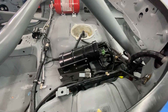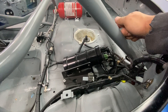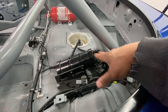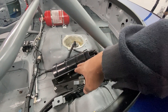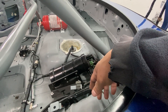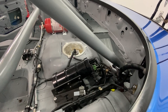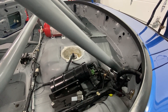A little bit about the surge tank — this is a Radium surge tank setup. What the surge tank does is it takes fuel out of the fuel tank and puts it into the cylinder. The cylinder itself has a fuel pump in it, and it allows you to run the tank very low without getting fuel starvation. The OEM fuel pump pumps fuel into the surge tank, which holds the fuel so you can have very little amount of fuel and still get fuel flow to the engine. It hooks right back up to the stock fuel lines and delivers it to the front of the motor. It allows you to get the car really light — if you want to use fuel as ballast, run it super low and never have to worry about fuel starvation.